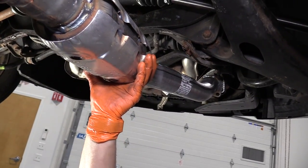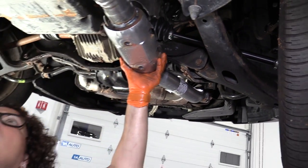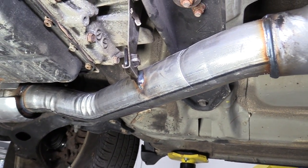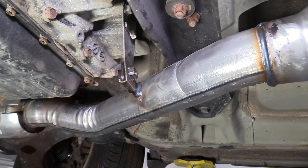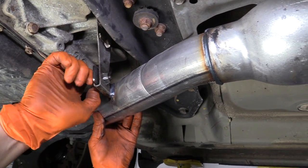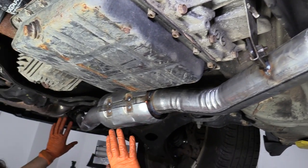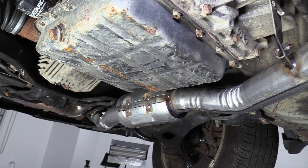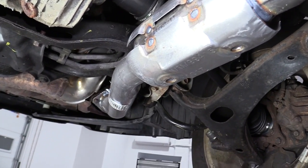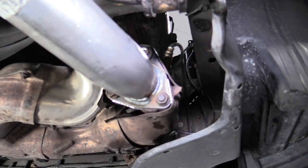So I'm going to line up the bolt holes — two long lower studs, top stud. That bracket has that flange on it, so it's holding it and I can go get my mounting bolt for that hanger and tighten it up. I'm going to put this finger tight because I don't want it snug — I want the nuts on the front flange to be able to pull the exhaust forward and make sure it's bottomed out. I've got three new locking nuts. See how the old ones had stripped heads. So I'm going to put those on and get my 14-millimeter socket and tighten those up.